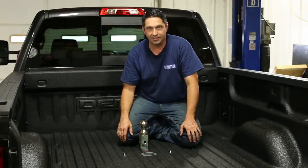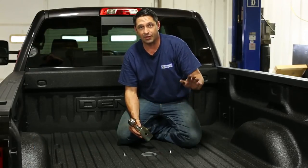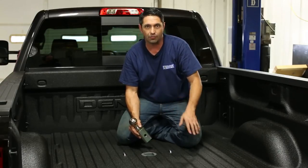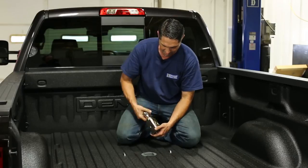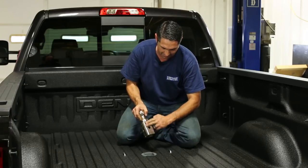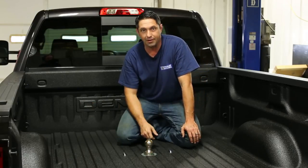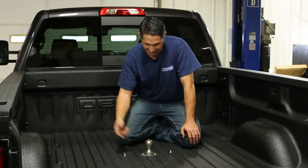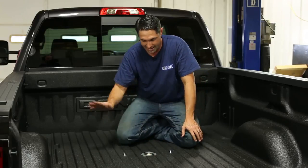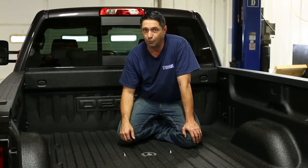After finishing the safety chains, the last step is to install the gooseneck ball. While you were under the truck, that was a good time to put the exhaust back into place, reinstall the spare tire heat shield, remount the spare, and reinstall the fender well liners. Apply a nice light coat of white lithium grease on the rounded corners of the ball — try not to get any on the flat spots, we like those dry. Insert the ball when you're ready to tow, engage the latch pin, and you're ready to go. When you don't want to tow, disengage the latch pin, turn the ball over into its stowed position for a nice flat surface, re-engage the latch pin — and in true B&W fashion, a hitch when you need it, a level bed when you don't.